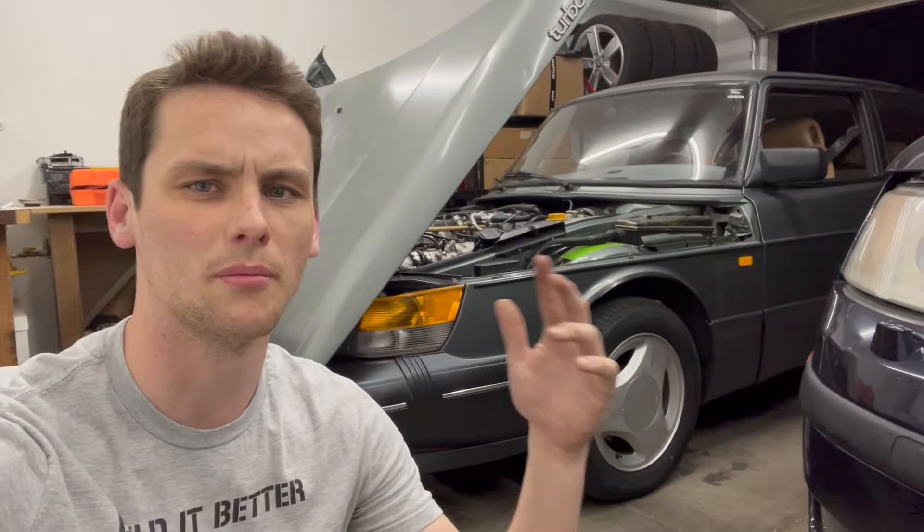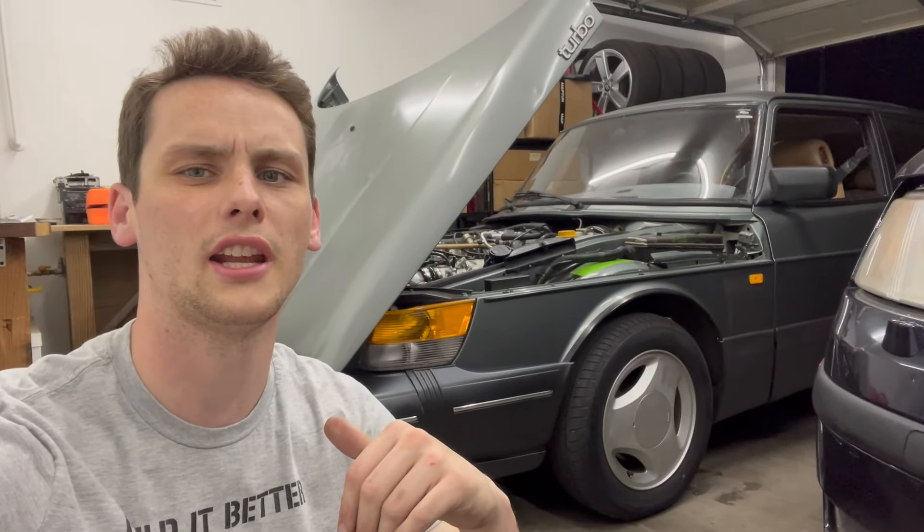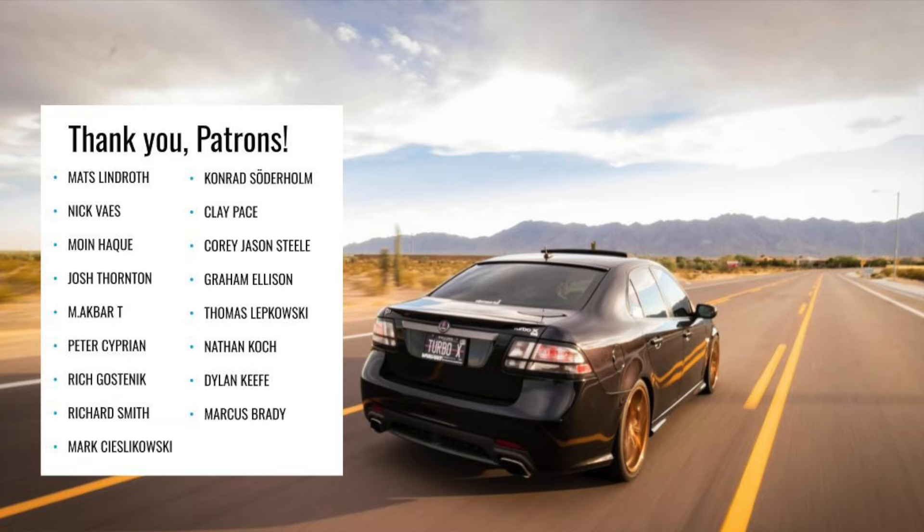The brake light is fixed. So maybe this serves as a reminder to all you 900 owners to check your brake lights and make sure your brake switch isn't faulty or gummed up like mine was, because it's one of those things you never really know until someone tells you. That is a very dangerous problem solved on my 900 — thankfully, not too difficult to fix. I also noticed on the little metal plate where the plunger pushes against, there was a lot of grease on that, so I think that was the root of the problem. I went ahead and cleaned that up to hopefully prevent this problem in the future. If you enjoyed this video, found it helpful or informative, give it a thumbs up. Check out my merch if you want to help support the channel, as well as my Patreon. I'll see you all in the next one.